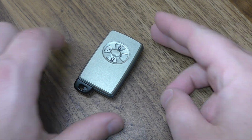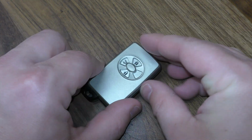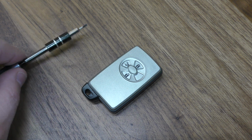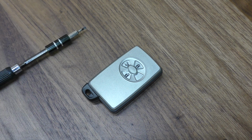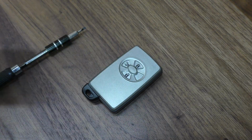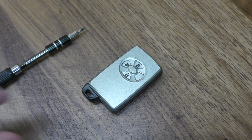Hi there, I'm going to show you how to change the battery in this Toyota Crown key fob. Pretty straightforward process. You do need a small flat tip screwdriver about this size and also one of the replacement batteries. This takes one of these 1632 batteries, and these can be gotten off Amazon for just a few dollars. There's a link below in the description.